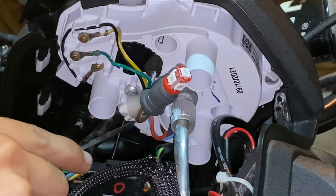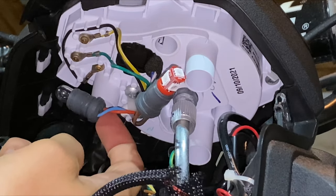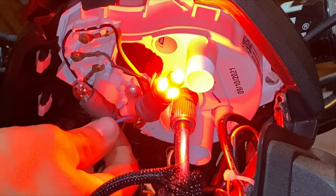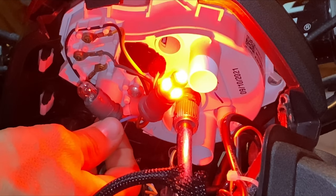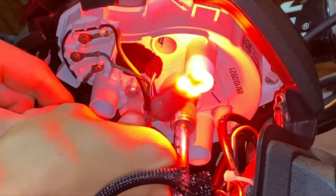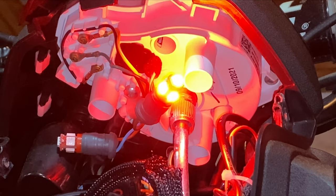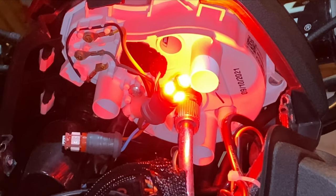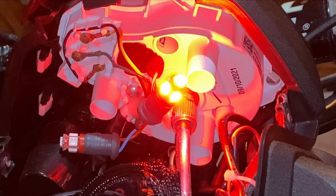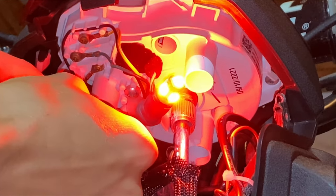So that's the background light for the speedometer — you have your red and blue wire there, and that's your turn signal one. There is the turn signal bulb — this is where we have an issue. Turn right: bulb comes on. Turn left: bulb comes on. But if I put the LED in, turn right: nothing. Turn left: something. Even having done the AC-to-DC conversion correctly, for some reason it just won't fire.